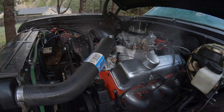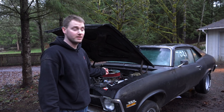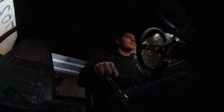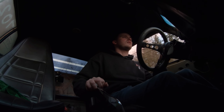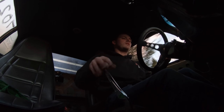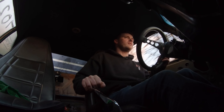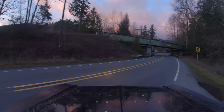I get a laugh out of the fact that we've had a nasty-looking engine in this thing for the last two years, and we finally get a good-looking engine in it — and now we finally cover it up with a hood. So here's the funny thing about this test drive: we forgot to unhook the vacuum advance before setting the timing, so it was about 15 degrees too retarded. And even at that, it actually still felt like it had more power than the 350. But that's also why sometimes it would backfire under acceleration.